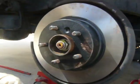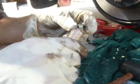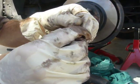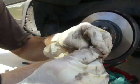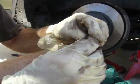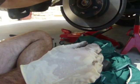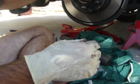You got it up here so people can see, Isaac? Yep. All right, make sure that we can see what's going on. This is anti-seize. So what I do is I coat the anti-seize on here, because that'll coat the threads, and then when this heats up and the rotor heats up, this won't get stuck in there if we ever need to pull this rotor off again. Although we're really hoping that we don't have to ever do it.